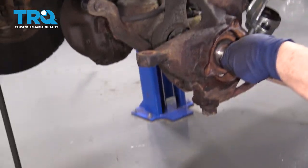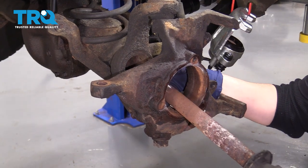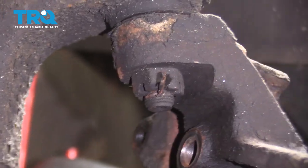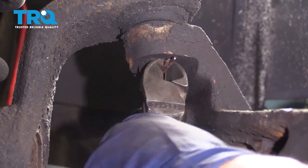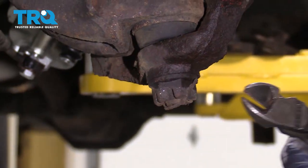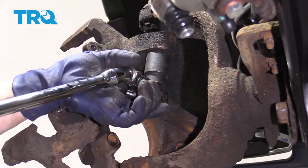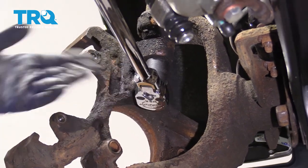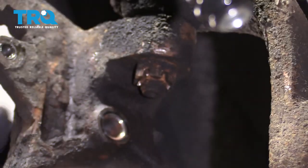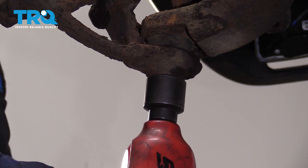Now you're just going to grab the driver-side axle and slide it right out. Remove the cotter pin from the upper ball joint — it might be pretty rusted in there, so we're just going to break it off, cut it right off flush. The socket will fit on that and the lower one looks just as bad. That 22-millimeter socket — I'm going to take the top ball joint nut right off. Then I'm going to take the lower ball joint castle nut off. That is a 28-millimeter socket.